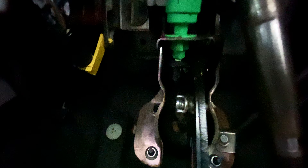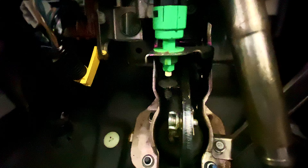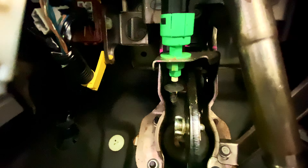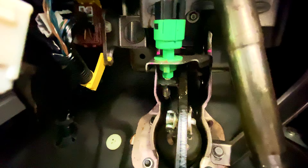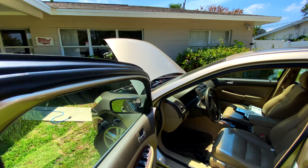What I did to fix it, just to save some money and time, is use a push clip. You can see the end of the green there, and as I push down the brake the white comes out. As I let go of the brake the white goes in — that's the plunger that actuates the brake lights. Brakes on, switch comes out. I let go of the brakes, the switch goes in, it depresses the plunger, and that tells the brakes whether to come on or off. We've just put that piece in there — if it works, it works.